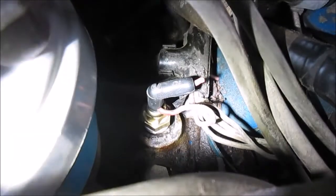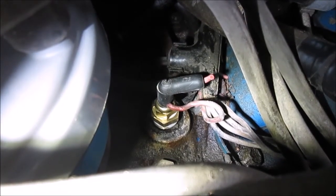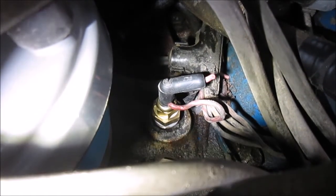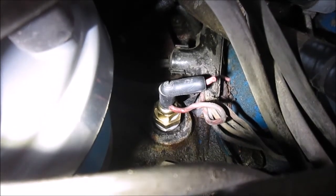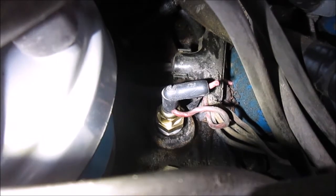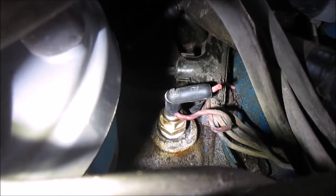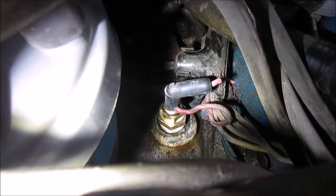I don't know how clear this will show up, but see how I cut the end off there and just shoved the wire in there for now? The big part is the old sending unit. I just chopped it apart, drilled it out, took a pipe tap, 1/8 inch national pipe thread, they're tapered, and rethreaded it to put that smaller sending unit in. Where you see it takes like the 1/2 inch wrench, the smaller bolt size. So that's about the best I could film.